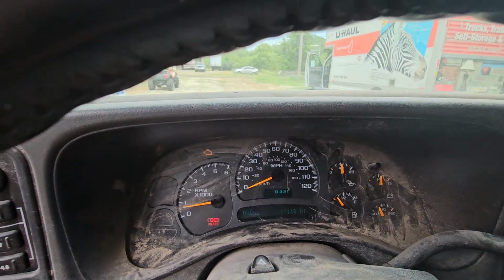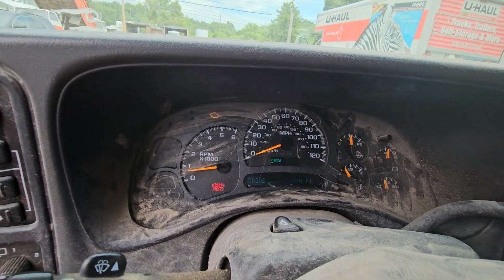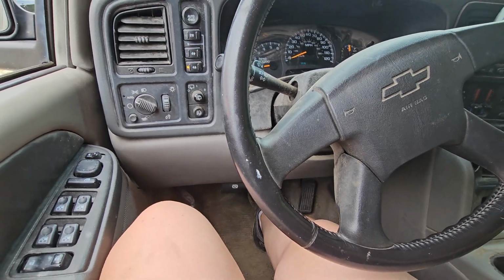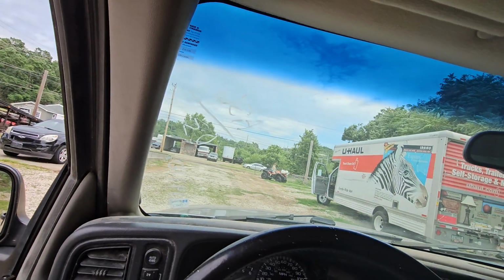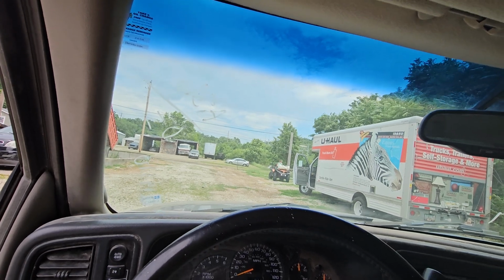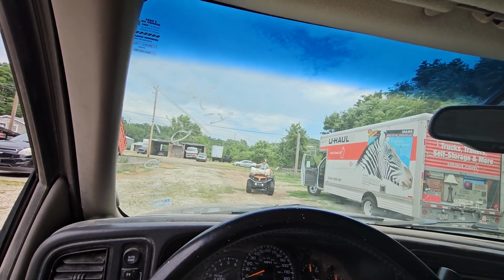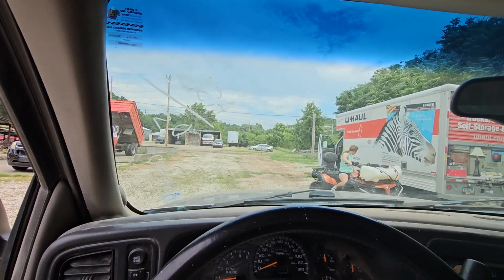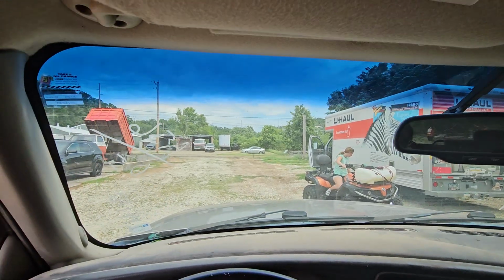We do have a check engine light. I don't have my computer with me, so I'll try and post that in the description. There was a brake light on there. Like I said, the brakes are weak. Even just right now, I feel it. They're weak, and so it's something you need to be aware of when driving. I checked the brake fluid. Brake fluid is full. And so it's more likely, you know, air in the lines or master cylinder or something like that. Because if the brake fluid is full, that means that it's not leaking anywhere. So you're probably looking at more master cylinder type thing, or potentially air in the lines. But that's kind of where I would be guessing on that.